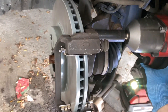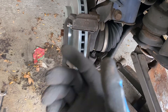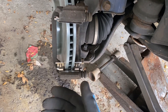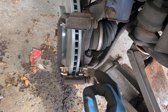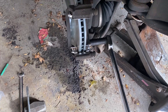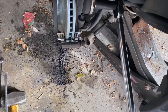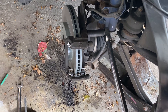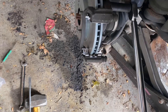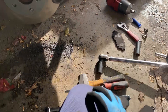I highly recommend torquing steering and brake components. If you don't have a torque wrench, you're going to have to use your best judgment. I believe the torque spec for these bracket bolts is in the realm of 80 foot pounds. The number one setting on the half-inch Milwaukee was spot on. My friend, the sun is providing some much-appreciated warmth here.